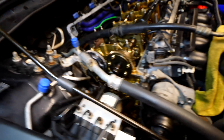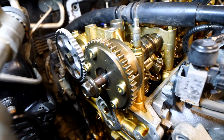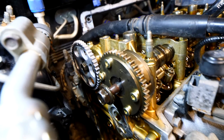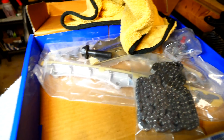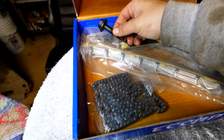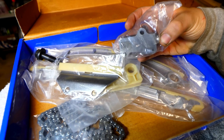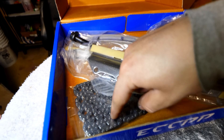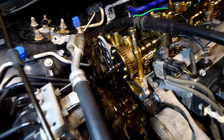Interestingly, my car doesn't necessarily make that noise, which is surprising for a car with 200,000 kilometers on it, but I'm going to replace it while I'm in here anyway. I'm also replacing the timing chain, and I've got new guides — all of these are going into the engine. There's the new chain guide, a new bolt, another guide, another guide, and this right here is the main part: our automatic tensioner, which makes constant pressure on the chain against the sprockets to keep everything timed.